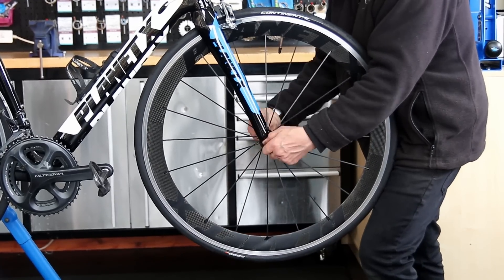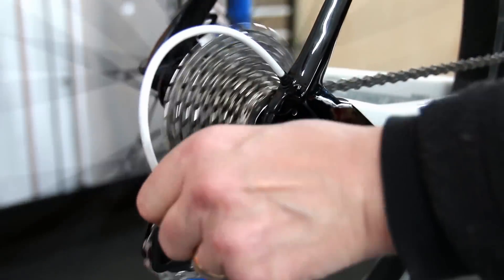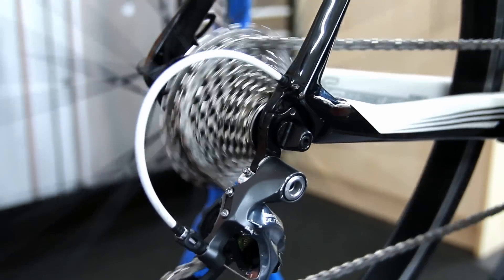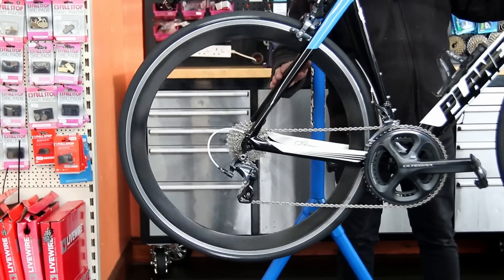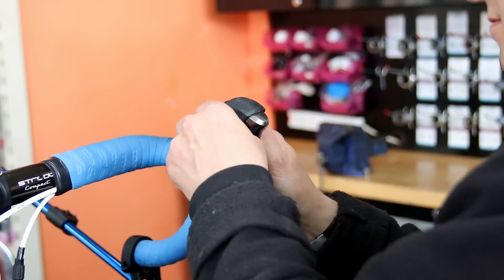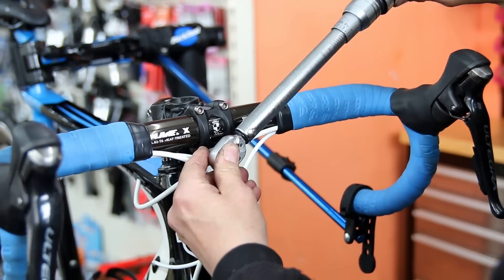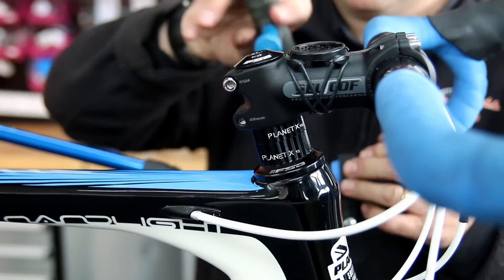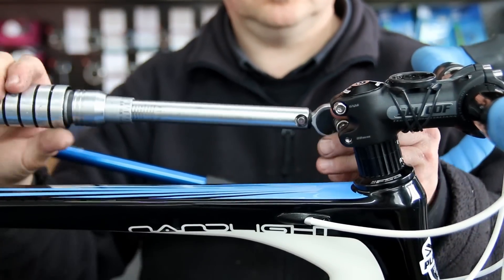Accessories go back on the bike before we remount the rear wheel. On goes the front wheel as well. Finally the heartbeat of the bike - the chain. This is just cleaned up, not a new chain, and now we do our final adjustments and tweaks. With this rear derailleur we actually had to adjust the b screw and the low screw to get it right. The low screw position and the b screw using the original chain should never really have needed adjusting after putting the bike back together, but they weren't quite right from when the bike came in so we got those spot on. Check the brakes - make sure everything's centrally correct before running through the bike with a torque wrench. We torque up the shifters, pop down the hoods, check the crown bolts - they were a little bit loose. The spacers for the stem: the Planet X logos weren't lined up so we lined those up to the front of the bike nicely.